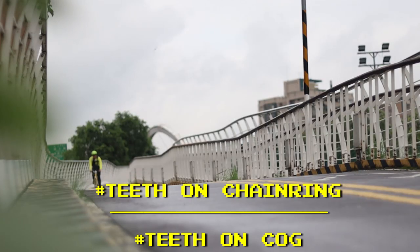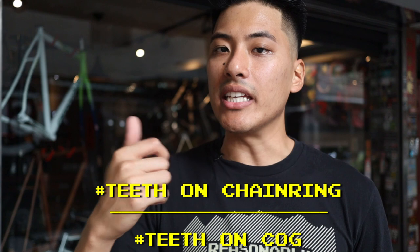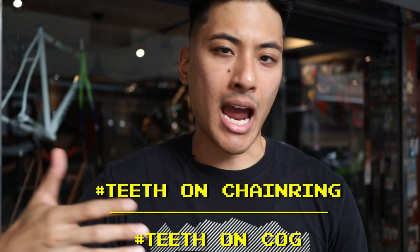If you want to learn more about how to choose the gearing that's best for you, consider checking out my fixed gear gearing guide for a more in-depth explanation. To find your ideal gearing, first find out what gear ratio your fixed gear or single speed has and use that as a frame of reference. Then determine whether you want to go up or down in gearing. Going up — either by increasing the chainring teeth or decreasing the cog teeth — will give you a higher top speed but make the pedals harder to push, making it harder to go uphill. Going down — getting a smaller chainring or a bigger cog — makes it easier to pedal uphill but gives you a lower top speed. If you want to change your gearing, I suggest changing your cog size, since a one-tooth difference on the cog makes a much bigger change in ride quality than a one-tooth difference on the chainring.